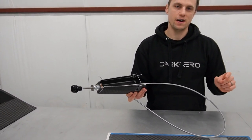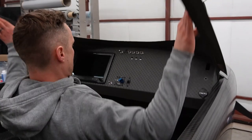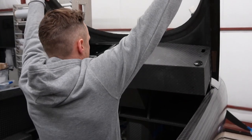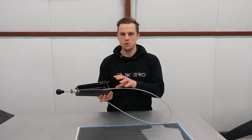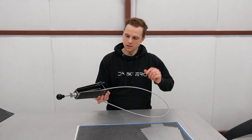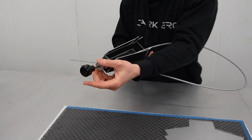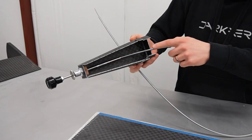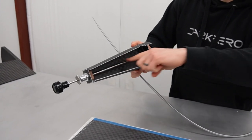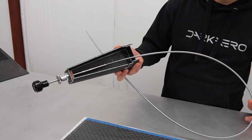This is mounted on the aircraft in between the pilot and co-pilot, independent of the instrument panel. As you may have seen in previous videos, the instrument panel actually lifts up with the canopy itself, so this will be mounted on the wheel well so it doesn't move with the instrument panel. We have a friction-style throttle knob so you can move the position of it and lock it into place. You can see how, before I close this out, it interfaces with the inside — there's plenty of room in here for it to be mounted.